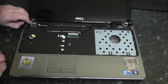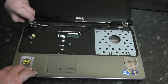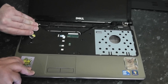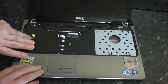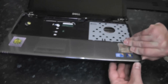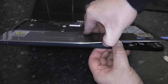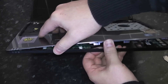The next thing we can do is unclip the palm rest. This is probably the most difficult part because it's snapped in nice and tight, so start on one corner until you get a good purchase point where you can get a spudger or your fingernail under there. Take it really easy. You can use a pry tool or similar — just put a bit of pressure on these little plastic clips and they should pop out. Don't use too much force.